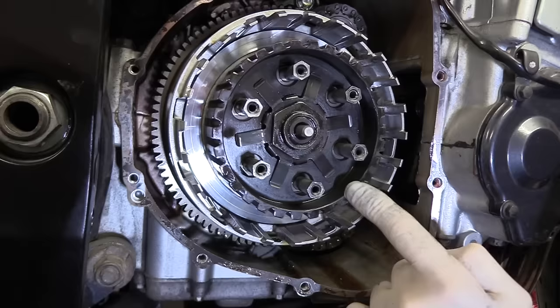Okay, so when you've got them in and everything's snugged into place, the springs need to go in two or three increments rather than all the way in. So don't screw one all the way in and then do the next one. Even in a star pattern, they must go in a couple of turns at a time. So all I tend to do is start with one, two, and then one, two. Just keep your star pattern,